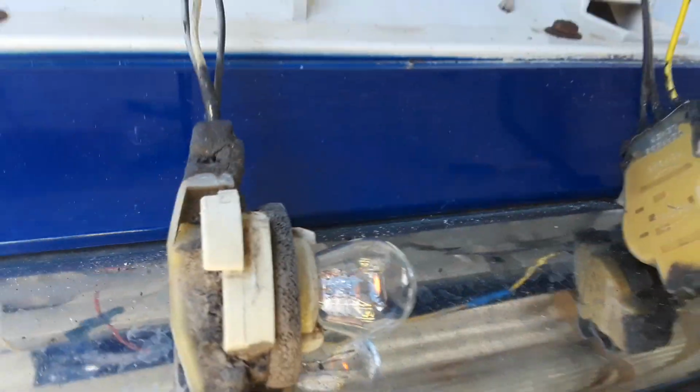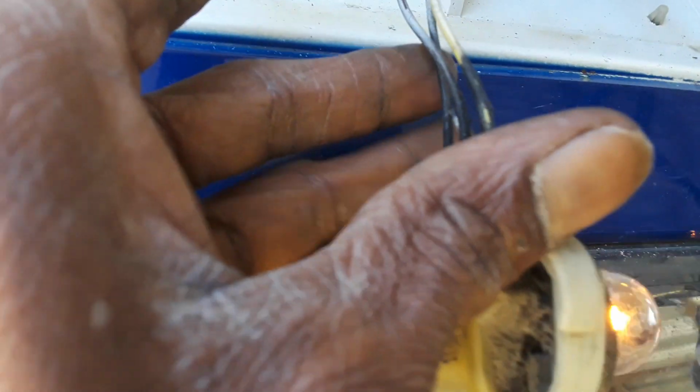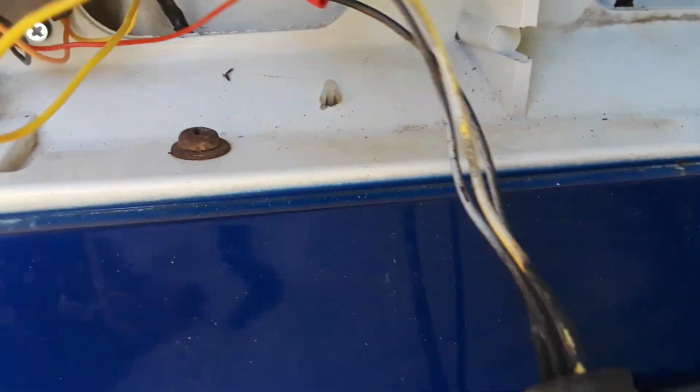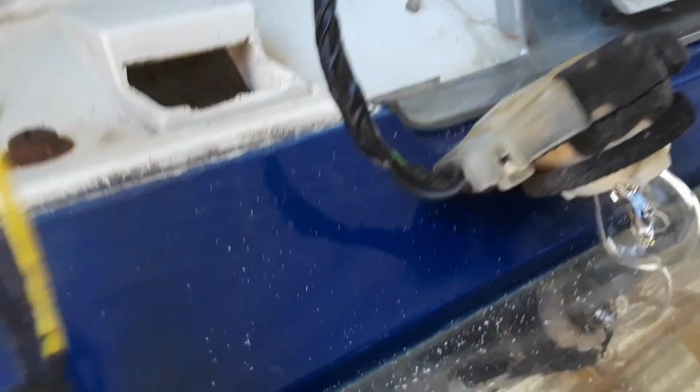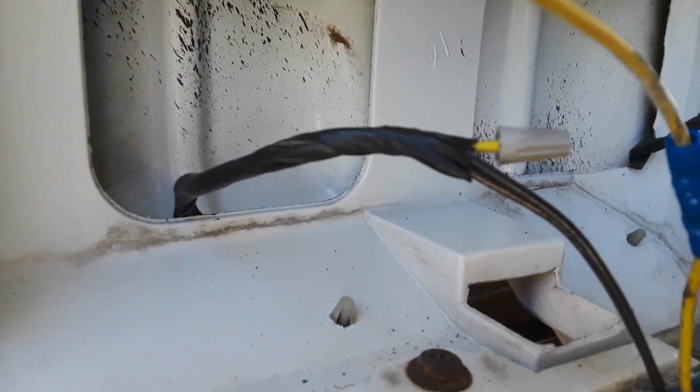So these two, the second and third lights, are identical as far as wiring goes. You know, one black, one brown, one yellow. Same here, one black, one brown, one yellow. So for the middle, it's the yellow wire on this module. Connected that to the yellow wire. The ground and the brown reconnected it from the original light, and the end, the yellow wire, which is the first flash, and cut off that clip.